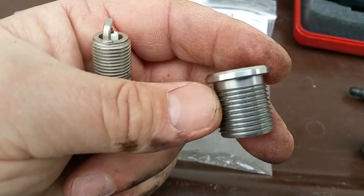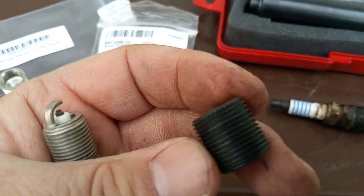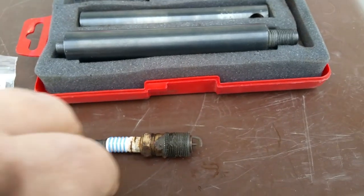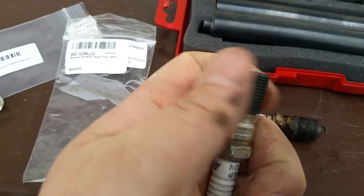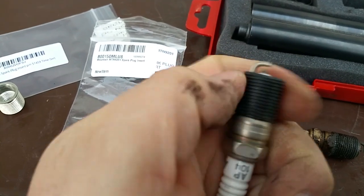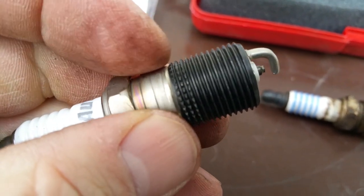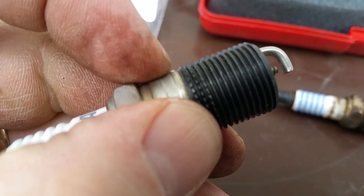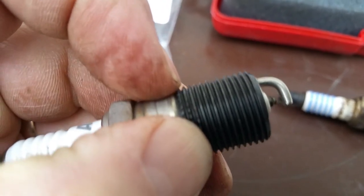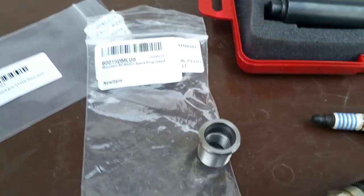Even if it did come out, you put the spark plug back into it and you don't have to worry about driving it through the head. The CTA brand requires some finesse — what I wind up doing is putting the sleeve back on using a bunch of cloths around the sleeve and a pair of pliers, forcing the sleeve back onto the spark plug so it follows the taper and expands the top, preventing the plug and sleeve from being driven into the cylinder.